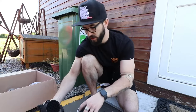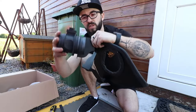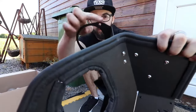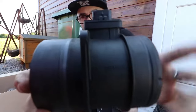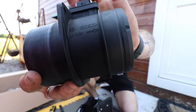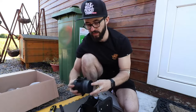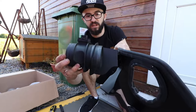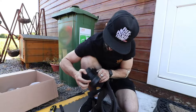This needs to be attached to our heat shield, and luckily the lads at Darkside have a bracket that is pre-fabbed with holes in the correct place. All we're going to do is push this in, and then go through the two bolt holes on either side with the supplied fixings. Also, when you take the MAF sensor out, you'll see an arrow for airflow — you have to make sure that the airflow is going towards the turbo, so the arrow is pointing in the correct direction. The clue is that the holes won't line up if you put it in the wrong way.